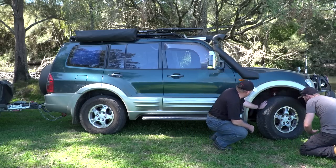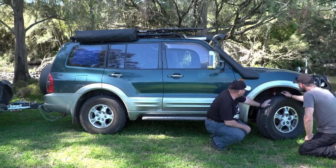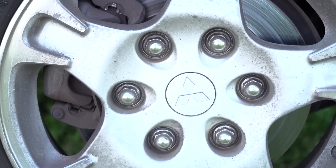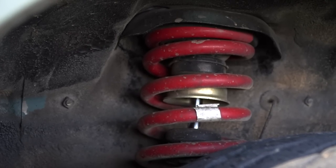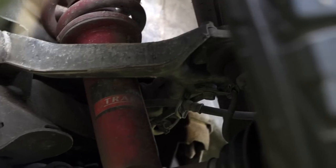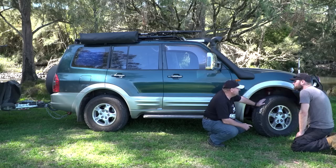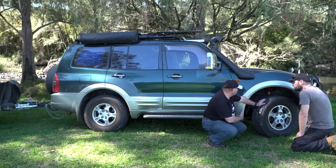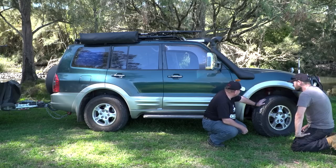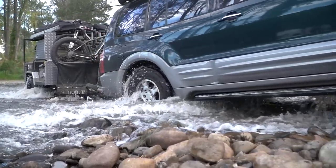I haven't gone overly big — they're 265s, not much more than factory — just trying to keep in line with what the vehicle was designed to do. Factory rims — kept it simple, they work well. For suspension I've got Pedders — just needed a little bit of lift, still wanted the kids to get in and out easily. So I've got 50mm of lift — coilovers, the Pajero's a factory coilover all the way around. With the trailer I use Airbag Man airbags on the back — manually adjustable using the ARB compressor in the car. When you've got a heavier load you adjust them up, and without the trailer you let them down.